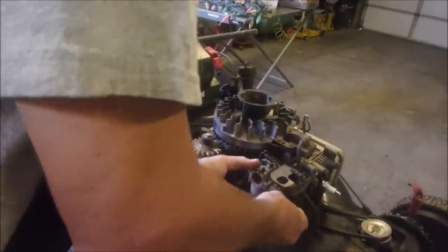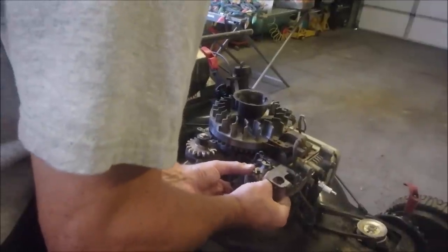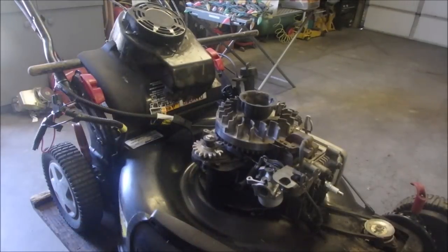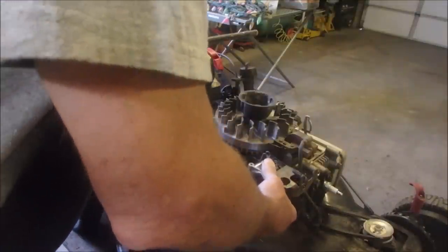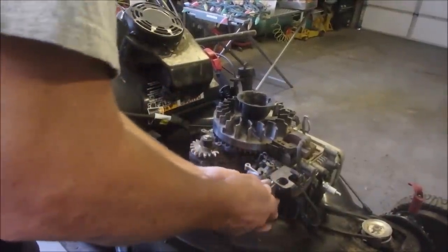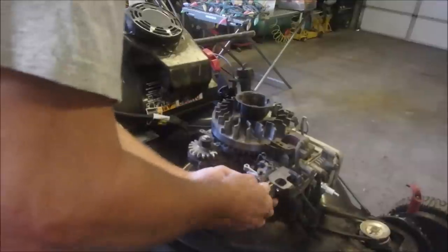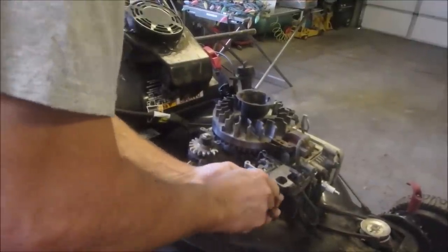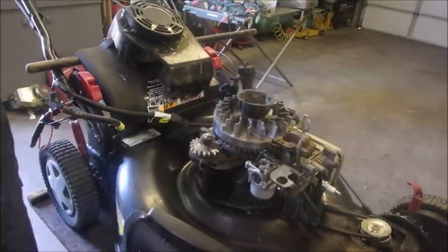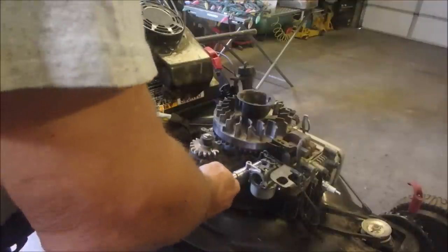These are probably the nicest carburetors to work on. This model of lawnmower, this Quantum, I actually prefer it to the Hondas. There's less fiddling around. They last just as long. We need fuel from the fuel tank now too, eh? As soon as we get this carburetor hooked up to the auto choke, we'll put the fuel tank on. Because we kind of know already that the coil works, right? The piston has been going up and down on it.